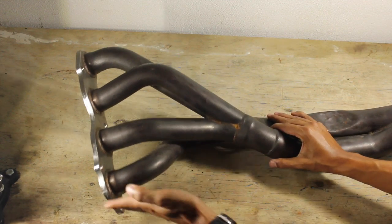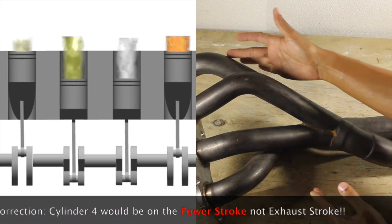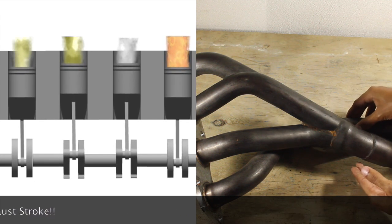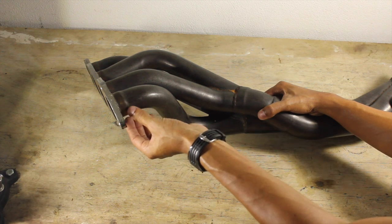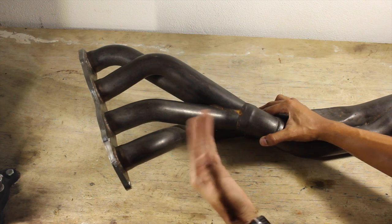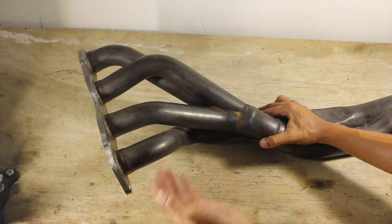What that means is, while cylinder 1 is on intake, cylinder 4 is on exhaust. The benefit of that is, as the exhaust pulse comes down, it will create a low pressure area in the secondary collector, which will help pull or scavenge the air from the intake cycle. As the intake valve is starting to close, there is an element of overlap that can be found in every camshaft. In most cases, this scavenging effect can be found and maximized on just about every vehicle out there.